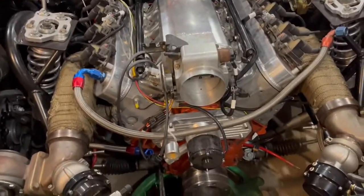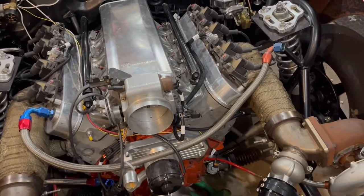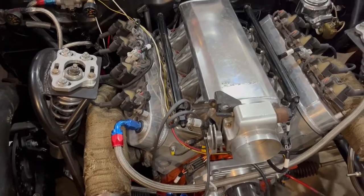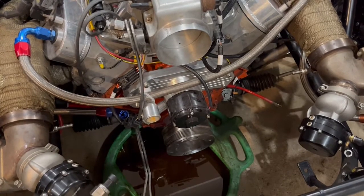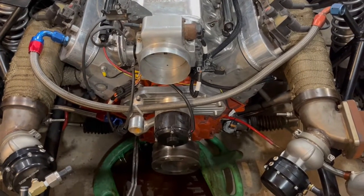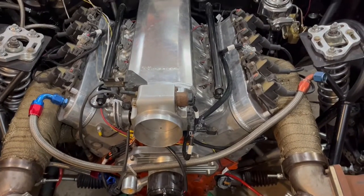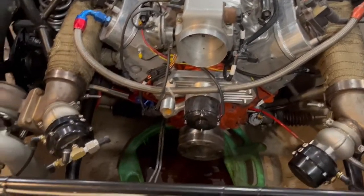So basically now where we're at is I'm gonna pull the turbos and the headers back off and then yank these valve covers. I'm gonna swap them out with a set of stock ones because I have some clearance issues with the headers to the valve cover. So I'm just gonna put stock ones on it, fix that up. And while I got everything apart, I'm gonna go ahead and yank the water pump, balancer, front cover. And I'm gonna swap out to a turbo cam and get the Magic Stick 4 out of this deal. I got a Thompson turbo cam for it. We're gonna slide in the front cover that's got dual dash 10 drains on it for the turbos, and then cinch it all back together, throw the push rods, rockers, everything back in, and stock valve covers, put the headers back up for real this time, mount the turbos for real this time, and keep plugging away.